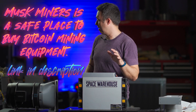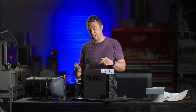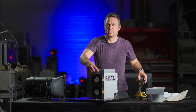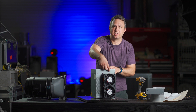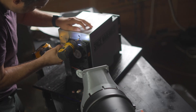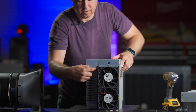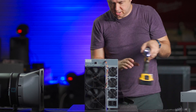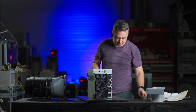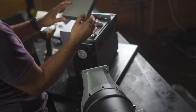I'm so sorry Blake and Chris, but I am going to rip this thing apart and do things to it. In order to install the fan spoofers, there is one screw here — there's a little button-looking thing here and there's a screw right below that. You want to hit that screw, and then specifically this one and this one. So those three screws have got to come out. Don't lose them. Then you can just push this button, lift that up, pull it towards you, and off.